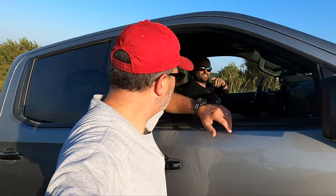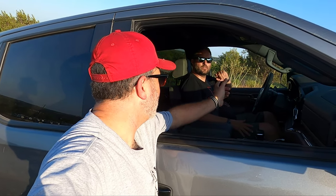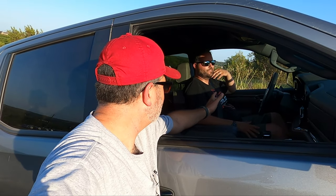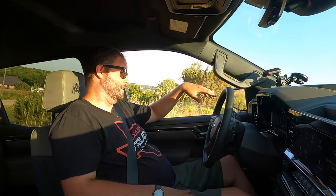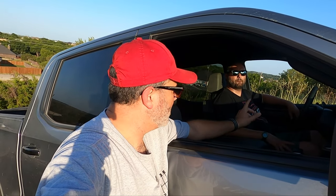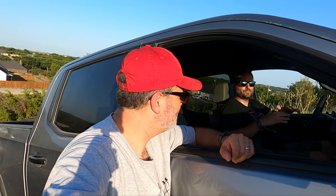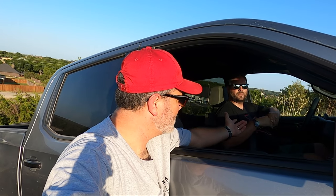Pretty impressive — the tires are grippy despite not looking super aggressive. We barely touched anything; the protection is thick. Worth noting: when wheel speed exceeded 25, it automatically unlocked the rear diff, so on trails keep speeds low. We also compared to the Sierra AT4X we tested previously — that truck had worse approach angle, needed four-low and both diff locks, and ultimately threw a transmission code. None of those issues here.